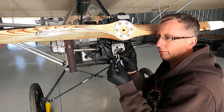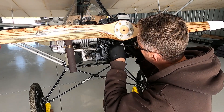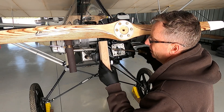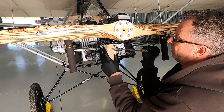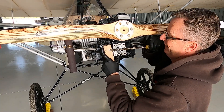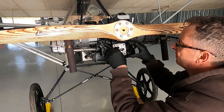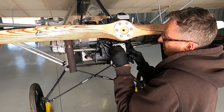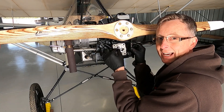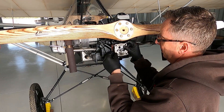I've cut the drill bit down to size. I'm just going to thread the chain through, then the drill bit through the inlet and outlet holes. Then I'm hoping I can pull on that chain and use some leverage — I've got a screwdriver through the chain and a timber on the side. And lovely, that has worked an absolute treat. Chain and drill bit out — just saved myself a couple of dollars with things I had lying about the hangar. I'm just going to pull the pump body out. Straightforward.